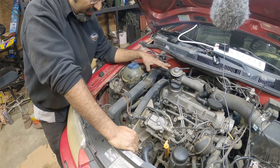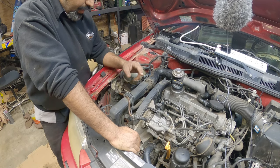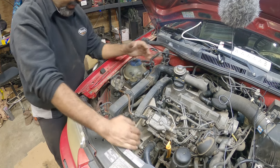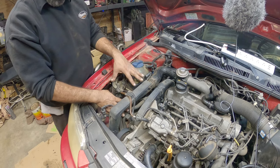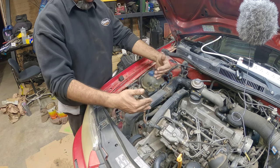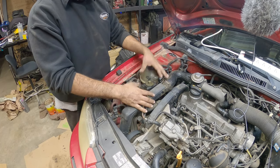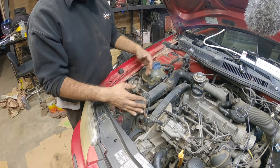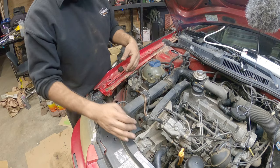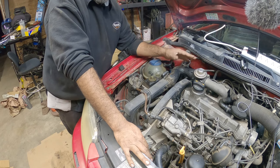We have to take out pretty much the boost pipes all the way down to the bottom — the lower boost pipe, the upper boost pipes. The timing cover, we have to move out of the way the coolant line, the coolant reservoir. The power steering reservoir has to be unbolted so you can move it over to make room for the motor mount to come out, and also to allow you to take the motor mounts and the timing cover out. Plus we have to remove the accessory belt — that way the engine is ready for a timing job.